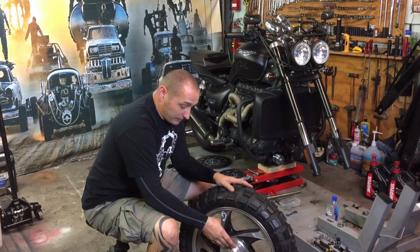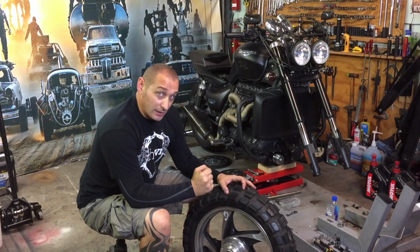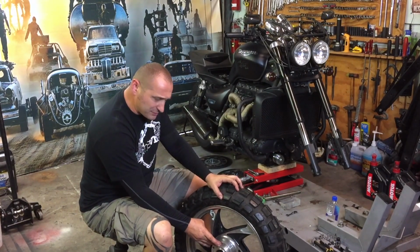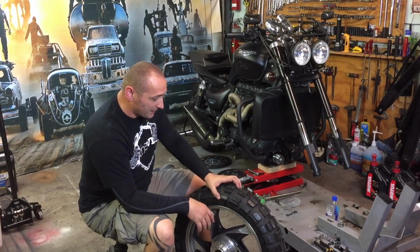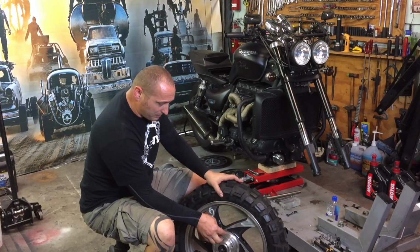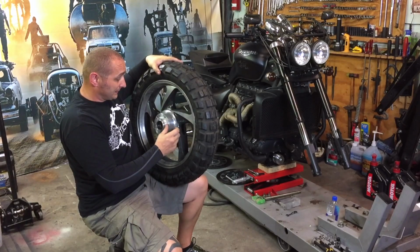That happened before. I didn't do the painting work, but one of my friends came to me and asked, could you check what's going on, because anytime I use the brake, it's shaking. It's wobbling the complete front end. I thought it was a shock, but it wasn't a shock. It was paint sprayed under the rotor. The complete wheel was sprayed with an ugly green. That was a Kawasaki though. I removed the paint with a blade, cleaned it nicely, and the problem was solved completely.